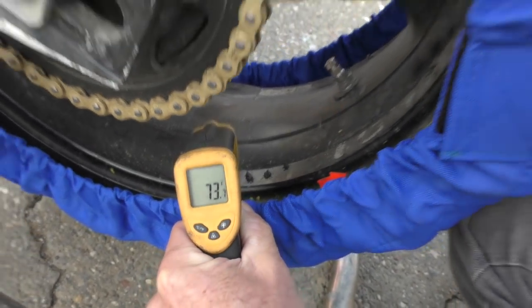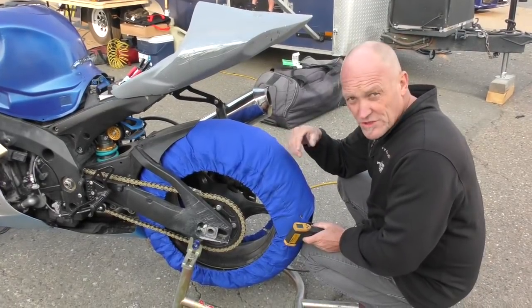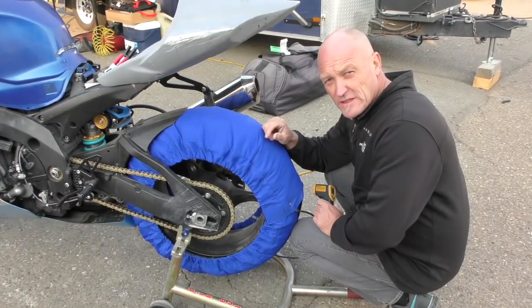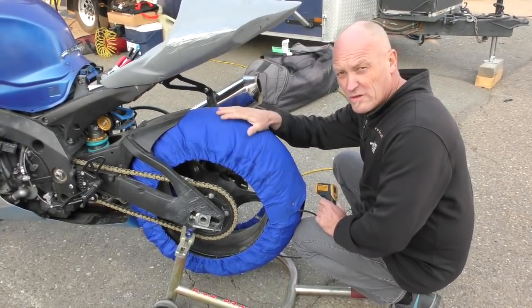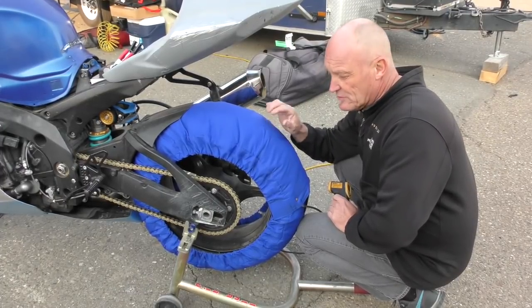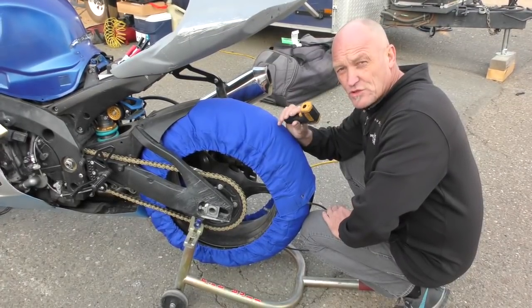The rim is reading 74 — almost twice as warm as it was — so there's very little heat transfer from the tire into the rim at this point. This is why when you go out, especially when it's cold, it takes three laps for the rim to get hot, the tire to sustain heat, and the two to balance out together — and then you can push. You'll also see some tire warmers, or even some people put blankets over the wheel completely, shrouded over, to trap as much heat as possible to get the rim as hot as they can. A lot of times for track days we'll leave the bike in the sun at 90 degrees to the bike because it's heating the wheel up — you get a two-for-one rather than keeping the bike in the shade.